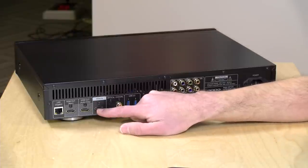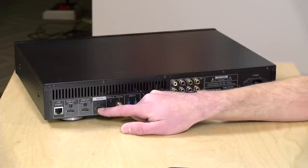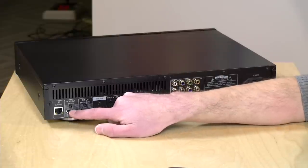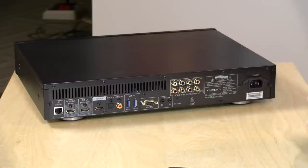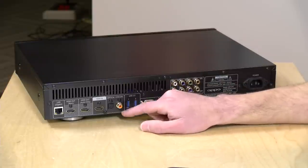The other cool thing about this device is that it has an HDMI input. This is not used for video capture, but it allows other 4K devices to connect up and still work with your receiver. For example, you could plug in the NVIDIA Shield — the video and audio will run into this, you can run the audio back out to your receiver, and have the video go to the TV. So you can basically add two devices and have that workaround from the copy protection issue. In some ways, you can ease into this 4K lifestyle and still use some of your 1080p equipment.